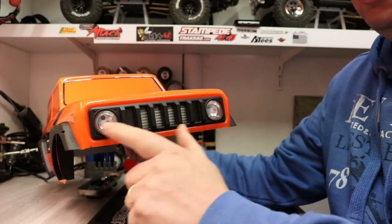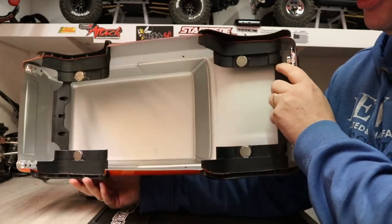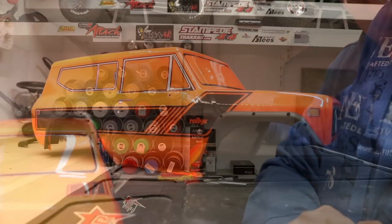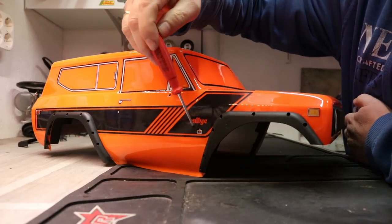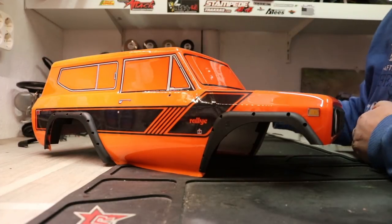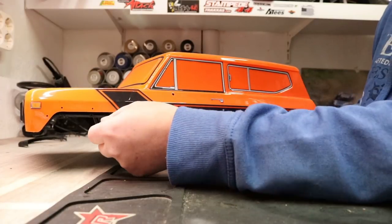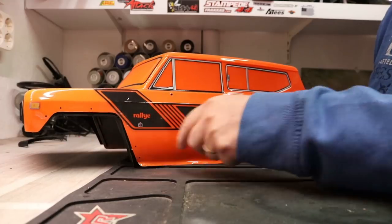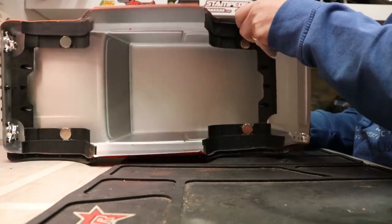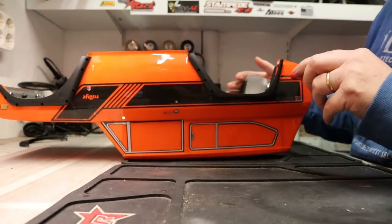Next step is to take off the grill, the lighting, the fenders, and all the plastic parts — everything on the inside. The fenders come off by unscrewing all the screws, same on each side. When you unscrew them you'll end up with the fender connected to the inner piece. You can see it's already loose on this side — those are the inner fenders — so it's just a matter of unscrewing all the screws.